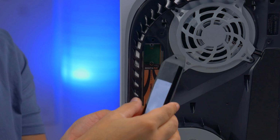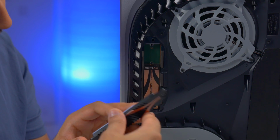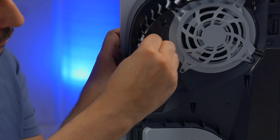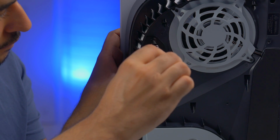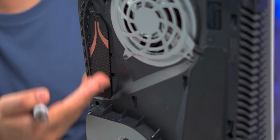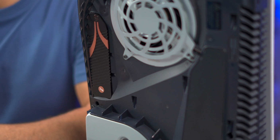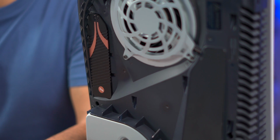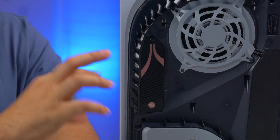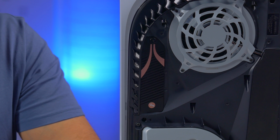Because the entire heatsink replaces the top metal cover rather than solely using the negative pressure method to cool the SSD, we end up utilizing the PS5 cooling fan to basically have active airflow over the heatsink itself. This means lower temperatures and obviously a more elegant cooling solution. This also means wider compatibility with other SSDs, and of course, we recommend using the Rocket 4 Plus for your SSD. The installation process is really simple and easy to do, making this more approachable for doing this upgrade to even the most nervous beginner. We think that we've created a great heatsink that overcomes some of the flaws of the PS5 cooling SSD method and have made the installation process far easier and more approachable than many other heatsinks out there on the market.